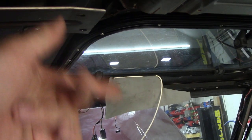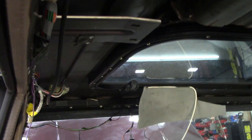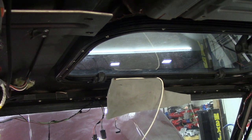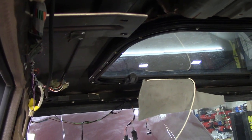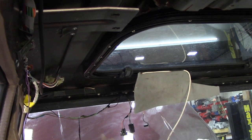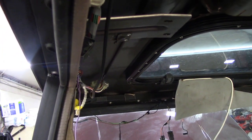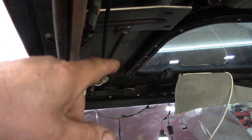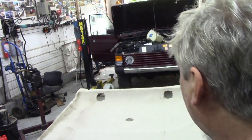You can see on this end where I double folded it over — we could trim that back with a Stanley knife or a little sharp X-Acto. A bit of black piping — Jim said he could make a bit of black piping to go into that gap and it would be really tight. And if we ever need to take the sunroof down again, we can easily unclip it and put it back in. We've made the headlining very tight to the bottom of that sunroof, so there should be no flapping about.